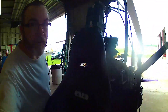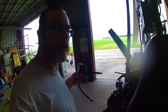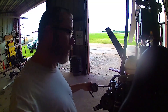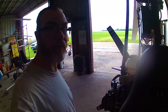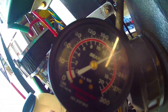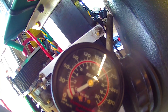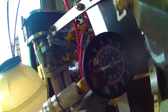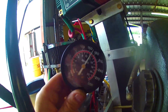All right, got it all back together, and we're going to start with cylinder number one, two, three, and then four. We're going to do a compression test again, compare it to our old numbers, and see what we get. I hope these two don't change — I didn't change anything there, but we'll see. We're getting 185 on cylinder one, 165 on cylinder two, and 166 maybe on cylinder three.